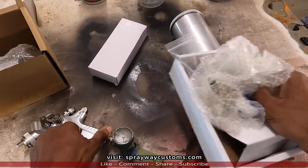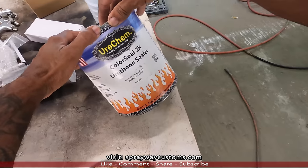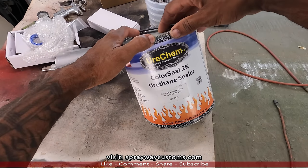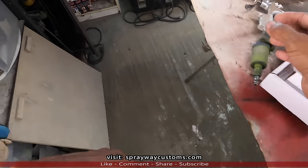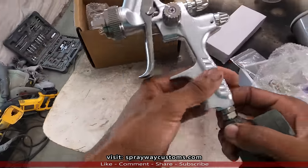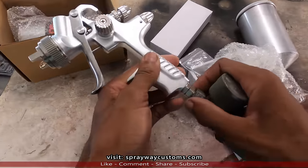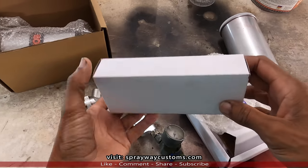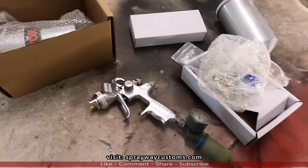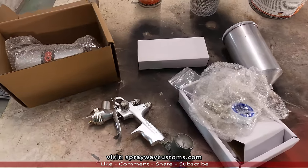And we're gonna be spraying a sealer. We're gonna be using this Uricam color seal. Put 1 coat of sealer on it. It's a dark gray. I'm gonna spray all of it out this gun here. The sealer, 1.3 tip, the base 1.3 tip, and the clear 1.3 tip. I'm not gonna use this other tip that came with it, the 1.7. So let's go out there and spray it back up. We'll blow it back up.